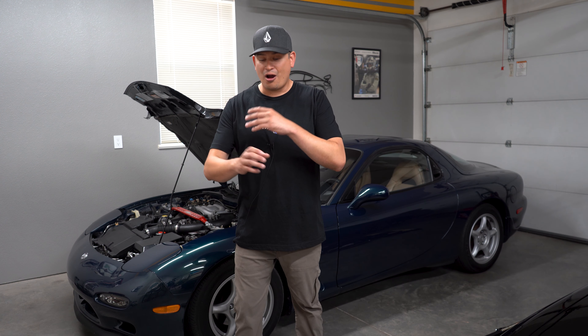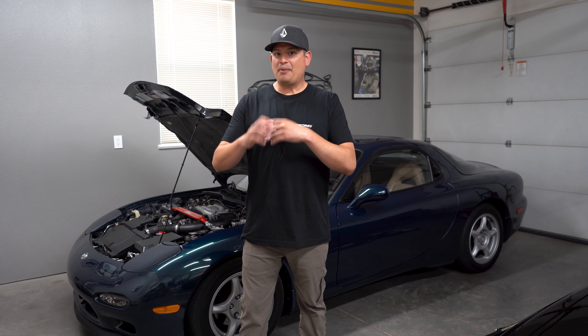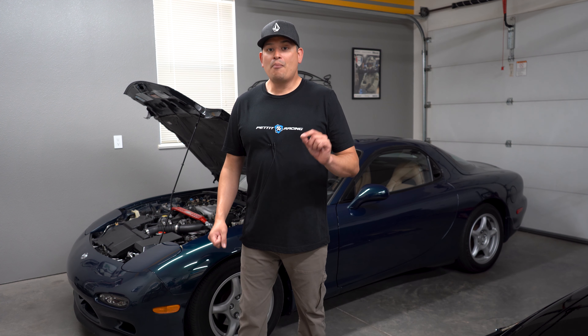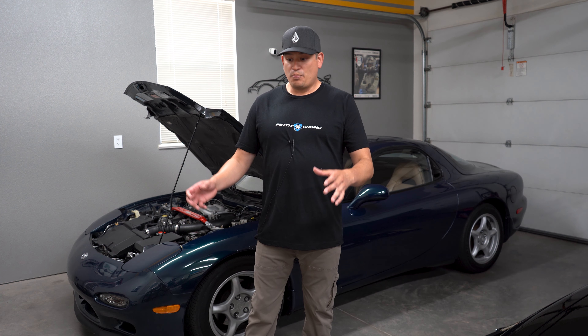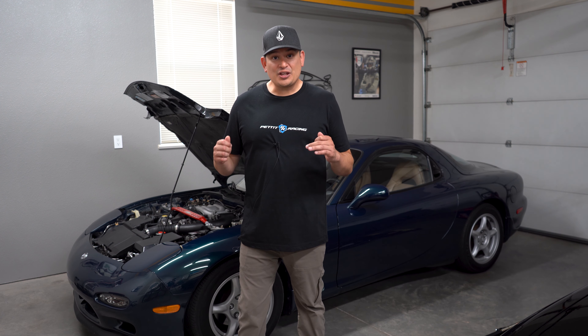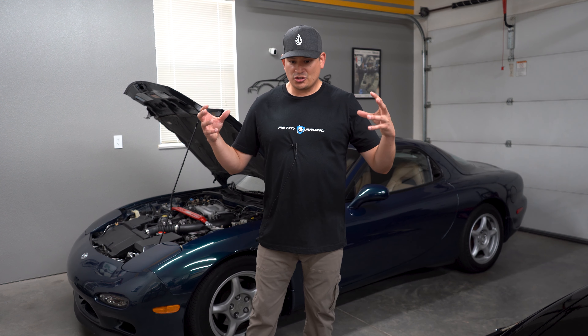When I was talking with Cam, he shared a piece of knowledge and advice that I kept thinking about for about a week. After the Mazda FD came out, Mazda issued a recall where you brought in your RX-7 and they put an extra harness where the fan relay is. What it did is when you turn off the car, the fans would come on. But Cam said that really doesn't fix the issue with overheating the engine as far as keeping those temps constrained.